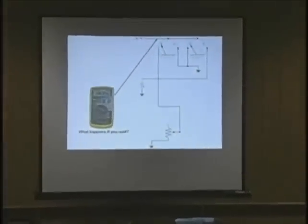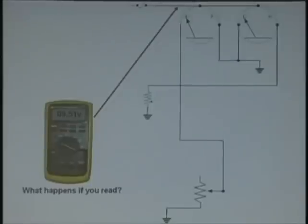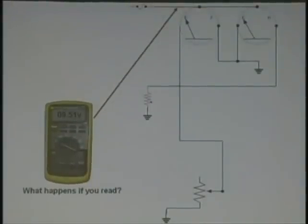Okay, now, let's say we had this reading right up here. Nothing else but that 951. What would you expect? What's the complaint? Both gauges aren't working properly. Well, with gauges, in actuality, you might find possibly some inaccuracy in there, but they'll probably work. They'll move at least, right? They'll do something. Yes, it's a bad voltage drop, meaning we should have 12 or 13 volts there. But do we pull a lot on that circuit?